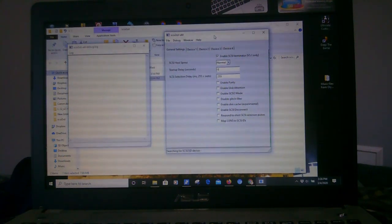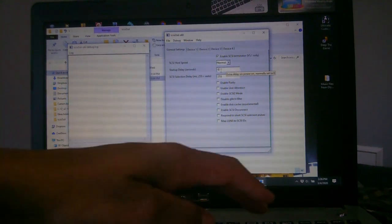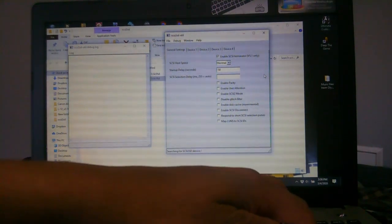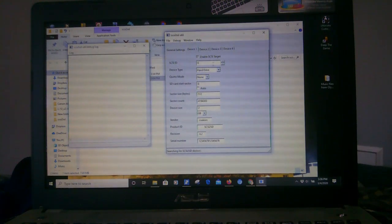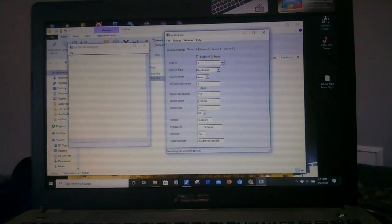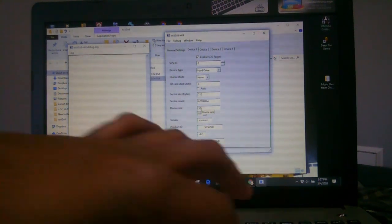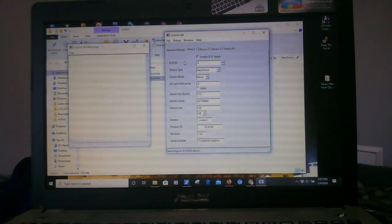Along the bottom of the screen it's kind of searching for the card. What you see me doing right here is changing the start time of the card — so if you set it to like 50 milliseconds and then change the auto to one, it allows the VS to start up with the card plugged in. I was having a lot of trouble with this, so I wanted to make a video so everybody can see all the steps. You can also hot swap it, but I didn't bother doing that.